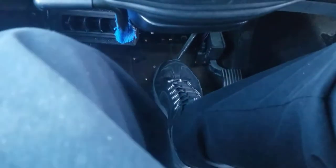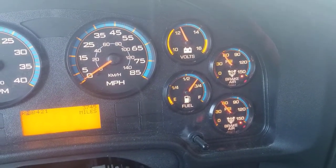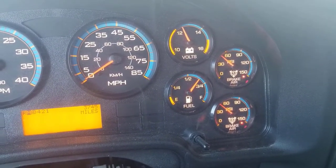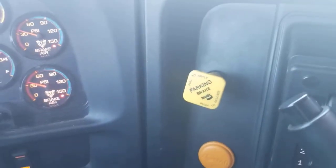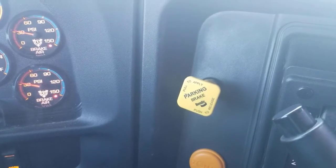So it's been a minute. Start pumping the pedal with a nice, steady, smooth pace. You see those needles dropping — there's the low pressure light and alarm. Continue pumping the brakes down and we're going to see that parking brake pop out. And that's the air brake test.